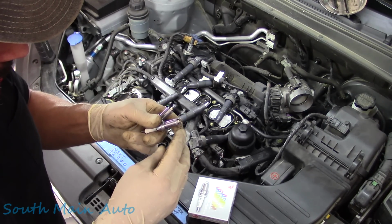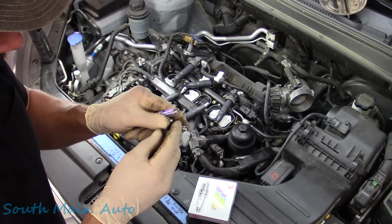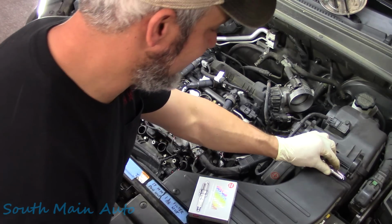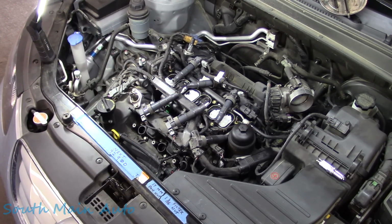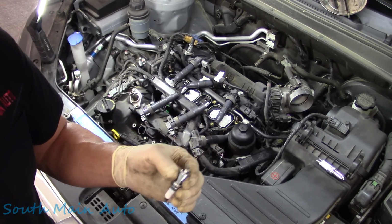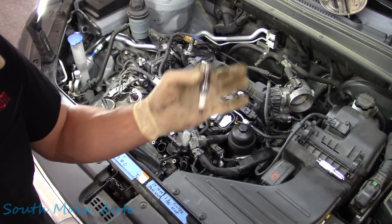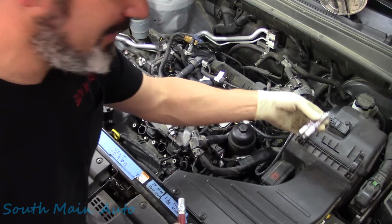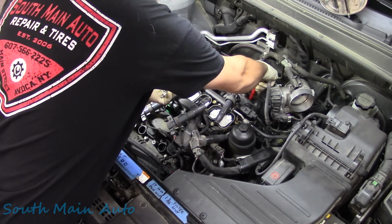So we're going to use a 1mm feeler gauge here. And I tell you what, you've got to be careful. That little piece of precious metal, well, it's precious. So don't go flecking it off. And I think the spec was 1 to 1.1mm-ish. Hyundai, Kia is very open, we'll say, on their specs of stuff. But I believe the torque spec was even like 15 to 22 foot-pounds. Just pick a number, it says.